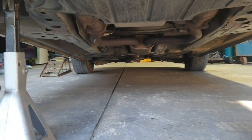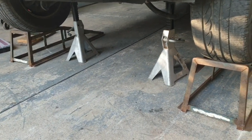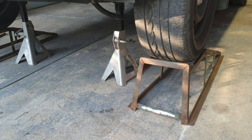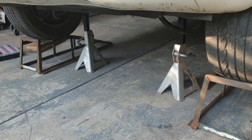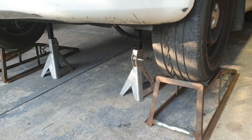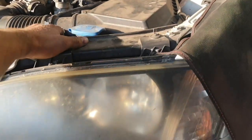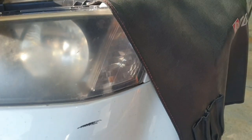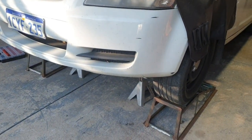I've just got a bash guard to rip off, which gives me a clearance of about 450 to 470mm to pull the gearbox out. For a bit of insurance I've jammed my car ramps underneath, just in case something happened to fail. Always check to make sure the car's not going to drop — give it a decent shake to make sure it's solid on those mounts before you get under there.